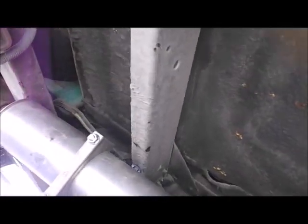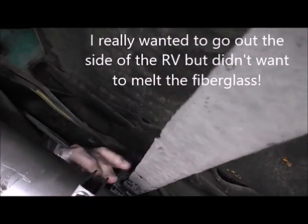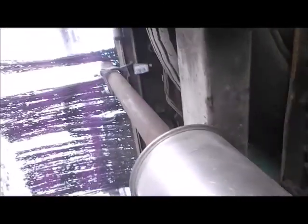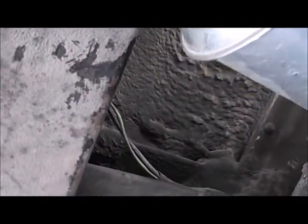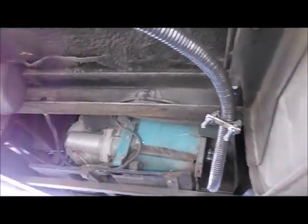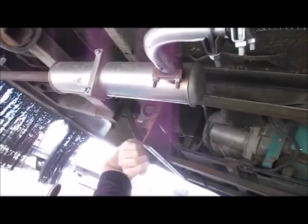I put a four-inch clamp on here, and the four-inch clamp goes up and comes off another hanger up here. All I had to do was shorten the tailpipe — I just wish I hadn't made it quite so short. I used a beam clamp on that, and it came out pretty good. I'm happy with it. It's pretty sturdy, there are no leaks, and it's pretty quiet. Now if there's a problem with the muffler, I can just go ahead and replace it.